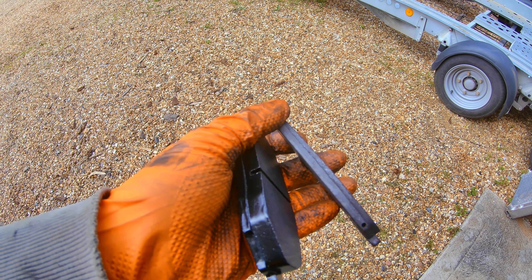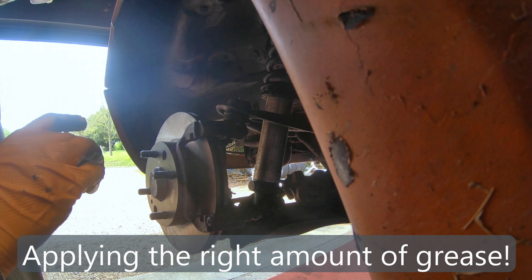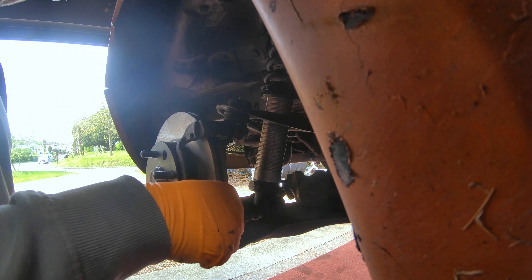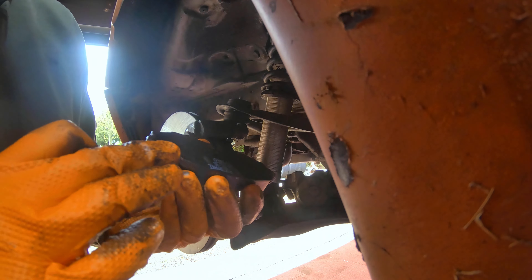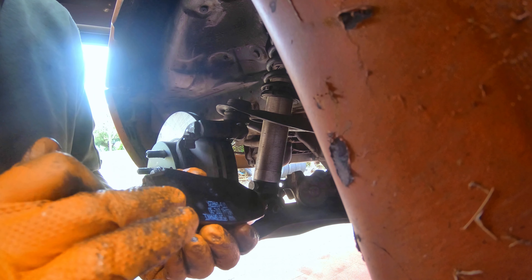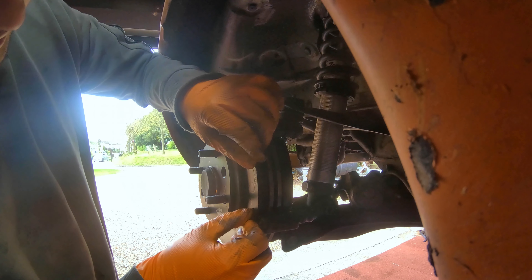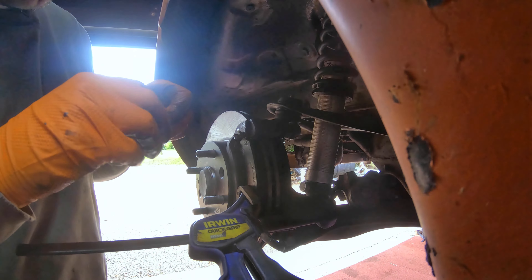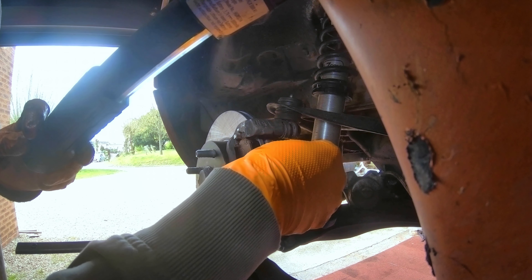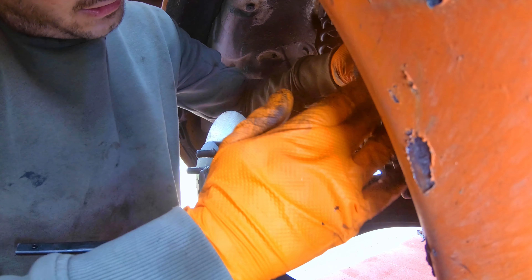You can see the old and new pads here side by side. I actually don't have any tips for fitting those pads in — it's a bit of a fiddle to get them in, but maybe someone in the comments has a trick. The fronts are always a little bit easier. These little spring clips go in the little holes, but they do their job of pushing out the brake pads, so if you're not holding them in some way they will fall out. It's probably worth taking this slider out and re-greasing it.